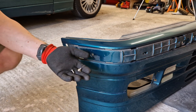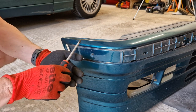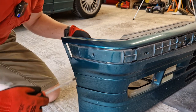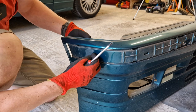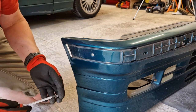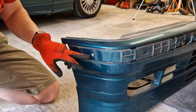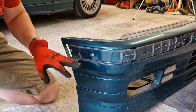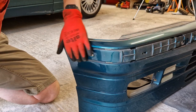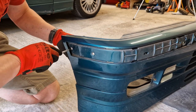For the repair, all you need is a couple of self-tapping screws — I'm not sure of the exact size but I've worked out they fit — and just a screwdriver. Align the bracket at the back using the existing plastic weld mounts as a guide, line up the holes, get your self-tappers in, and tighten everything up — super simple. I'd recommend getting stainless screws if you can, because you don't want them rusting and causing rust damage that seeps out from behind the cover. With stainless you get a nice strong mounting point, probably stronger than original to be fair.